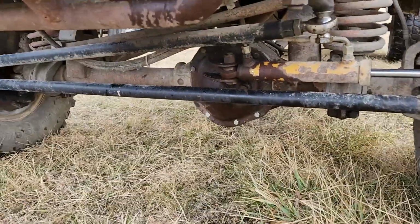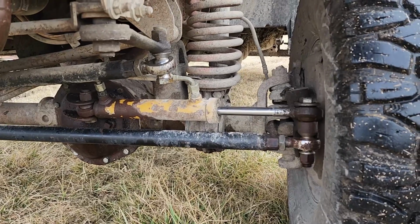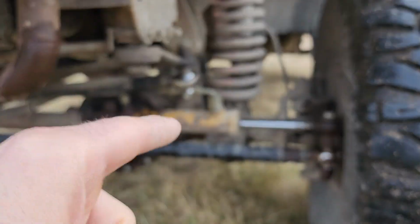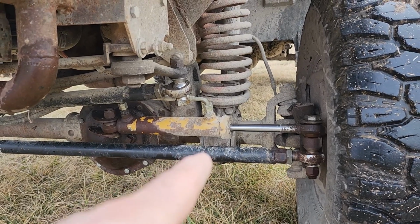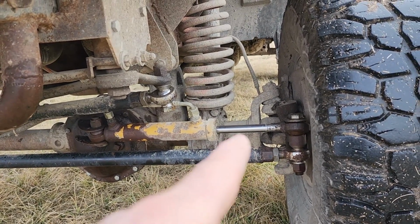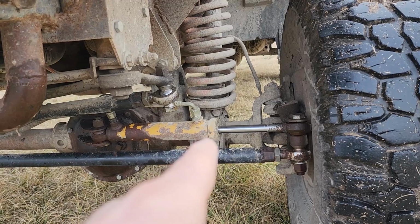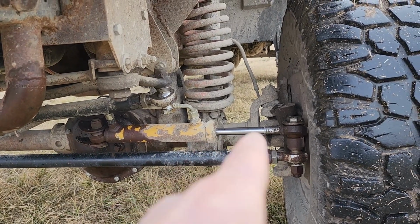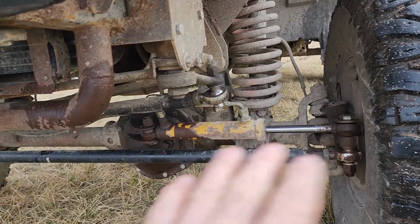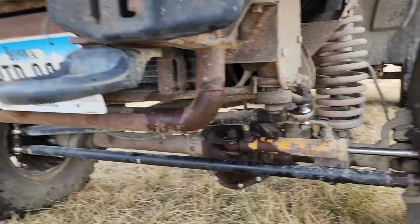Now that we've gotten past that, I can't tell you the exact amount that I moved the wedges in. I don't remember; it's been so long since I built this. One of the other things I did was tilt the wedges to where I wanted them, so I didn't have to use aftermarket bushings in the wedges to adjust my caster. And if I'm not mistaken, I probably even cut these off and re-angled them, because I wanted to get everything right. I re-tipped the wedges, and that got my pinion to where I wanted it as well. So that axle is the cat's meow if you want to adjust all that or do custom links or leaf springs. But anyway, now that we've gotten that out of the way, let's get back to the rest of the vehicle.